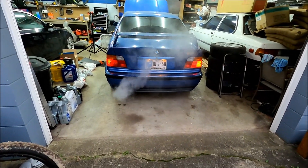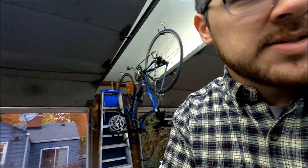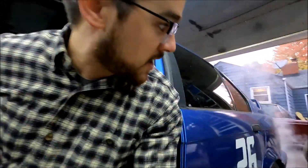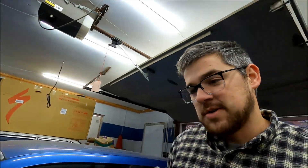Well, I think this is going to be it for this one — I don't think we're going on a test drive. It's coming up to temperature, holding temperature, not overheating, but I may have stumbled upon a bigger issue. We might have caused more damage than we hoped when we lost our expansion tank on the track. She's pretty much up to temperature now, and if you know the smell — it's a little sweet in here — and it's smoking pretty good. It's starting to idle a little crappy. You hear that popping and banging? So, maybe a head gasket replacement in the future. We'll compression test it at a later date. Maybe S54 swap it, maybe N52 swap it — who knows? That's a discussion for another day.